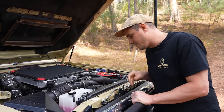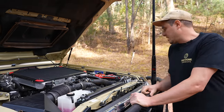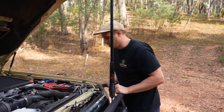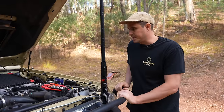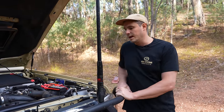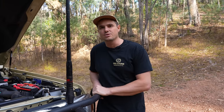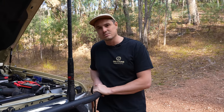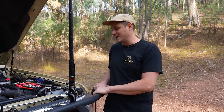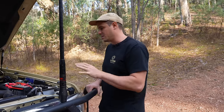You can get them for the radiator as well — I've been meaning to get one. We also have the catch can — it's a Provent catch can. Another little insurance policy for your car. You do have to remember to drain them every 5,000 k's, because you really don't want them to load up — that can do even more damage to your engine if you leave it. Just keep your maintenance up on it.